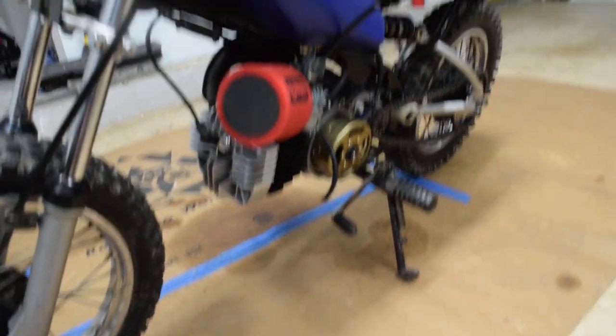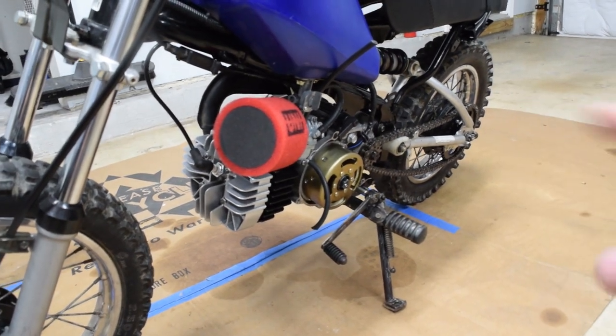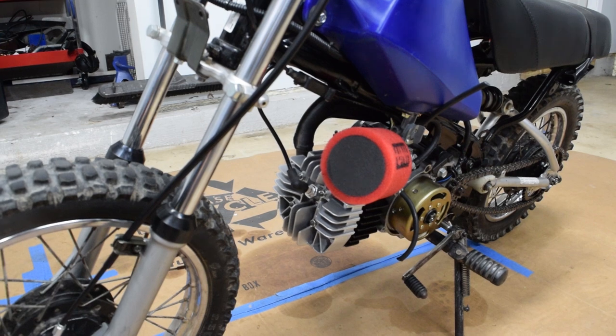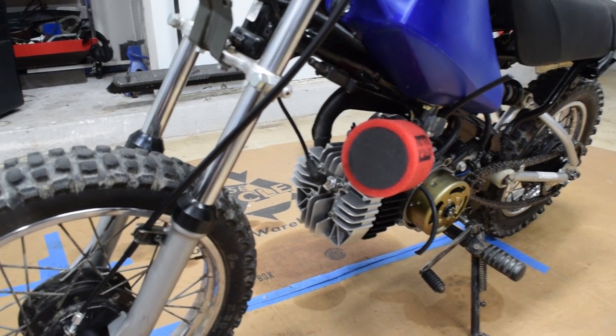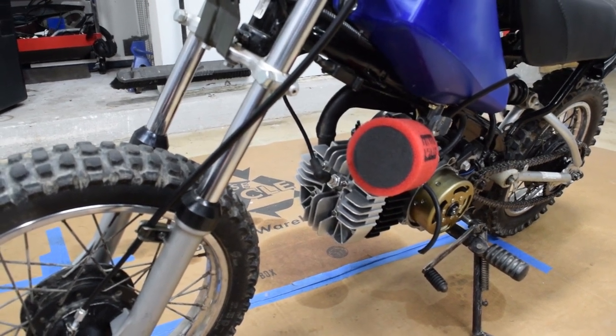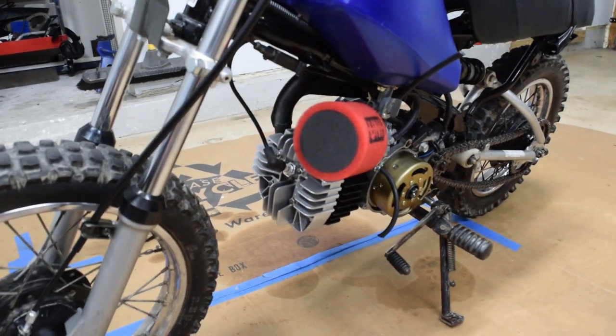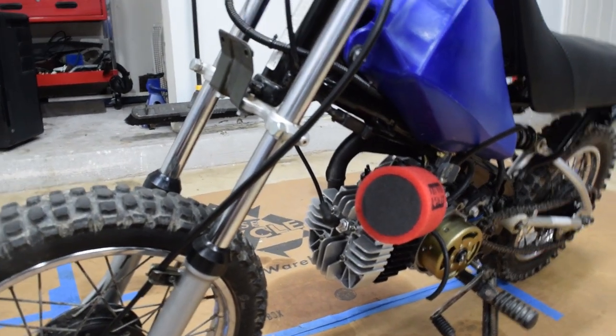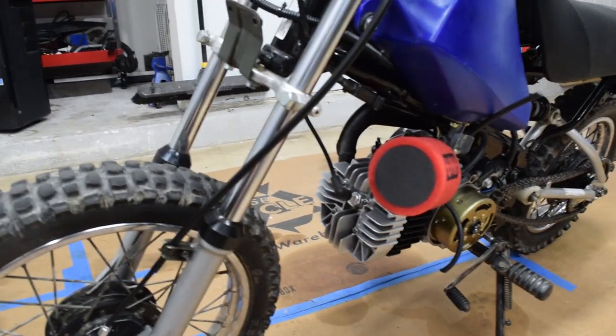And the back ones just need to be tightened more as well. The chain, obviously, is still loose, so that needs the new tensioners, so I'll order those. And then not use an impact on it this time. Every time I would change gears, the bike itself would buck because I think the clutches are sticking, which should loosen itself in time, but also when I go to the bottom end, I can take them all apart and clean them and make sure they're still good to go.